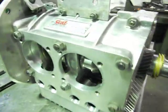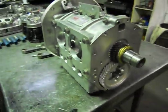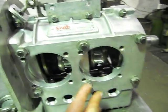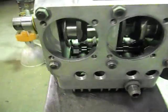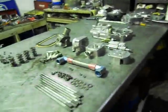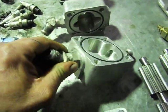This is a SCAT block — specifically what they call a SCAT killer case, which runs bigger studs through the block, has a better oiling system, far more chunky main webbing area, and has the facility for bigger bores compared to a normal standard block. She's very nice and clean inside, which tells you that someone actually fixed all the bottom end — went to the trouble of pulling it all apart, putting the crankshaft back in, the rods, and assembling it all up. But what they've done is put this old worn-out oil pump back on a brand new, big-dollar engine.